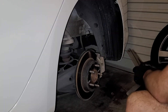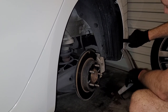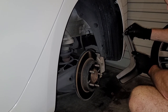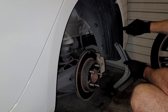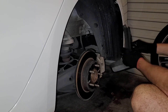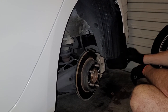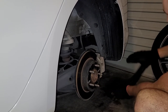We're at the rear left wheel now. In terms of fixing this one, I recommend leaving the existing screw in place because there's no corresponding hole that lines up. This hole at the bottom lines up with the car, but this other hole has no corresponding hole, so we're going to use one of the screws supplied with the mud flap to fix that one in place. It won't bulge out because it's quite recessed compared to the rear bumper.